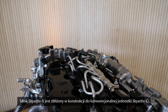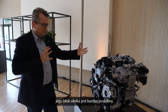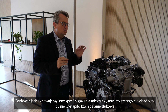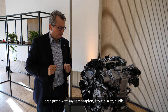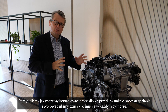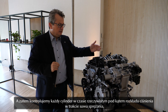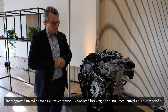This engine is basically very close to a conventional gasoline engine — the Skyactiv-G — and the base engine block is really similar. But because we have this different way of combusting fuel, we need to control it to avoid any kind of knocking, because as everyone knows, knocking would kill this engine. So we have thought about how to control the status inside the cylinder before and during combustion, and this is possible using so-called real-time pressure sensors.